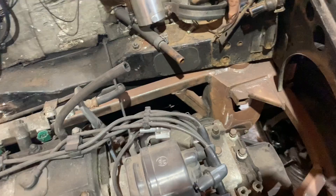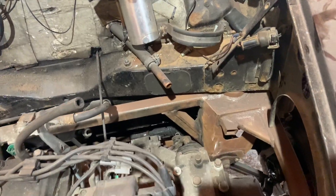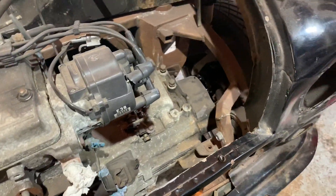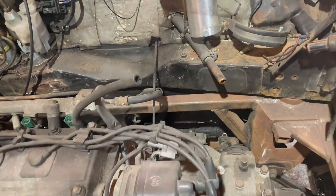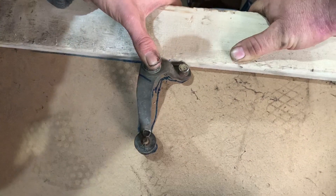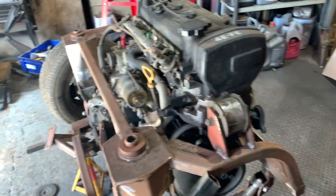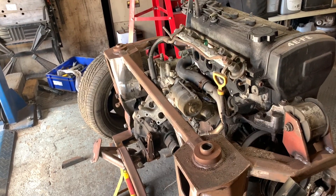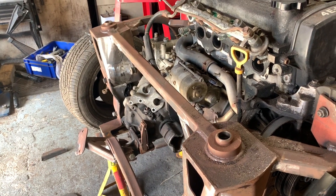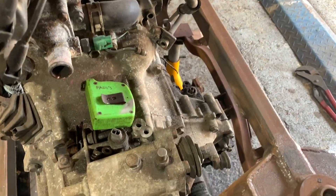It's going to need a bit more modification there. While the subframe's out we'll chop that bit off properly and make it all look a bit better - not saying we're going to clean the subframe up today, we're concentrating on the gear linkage, but while it's out, why not do something right? Jordan's just drawn around this bit of gear linkage because we need to cut that to make it fit near the subframe. Once we've got the angle of which way we're going to cut it, we'll know how to do the other end as well.